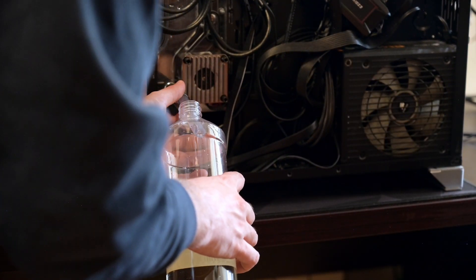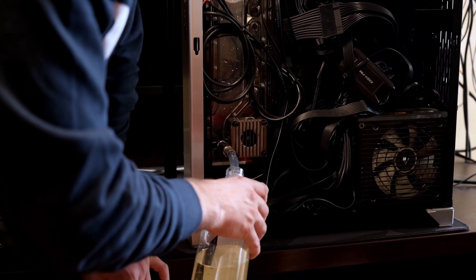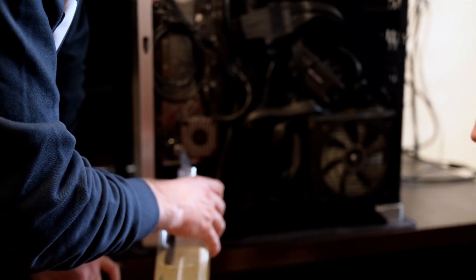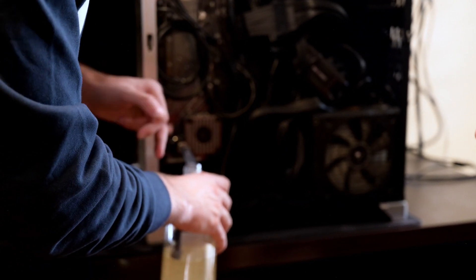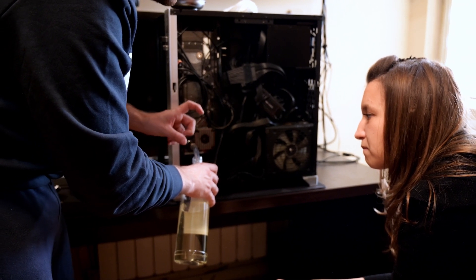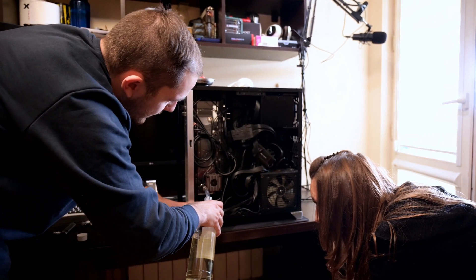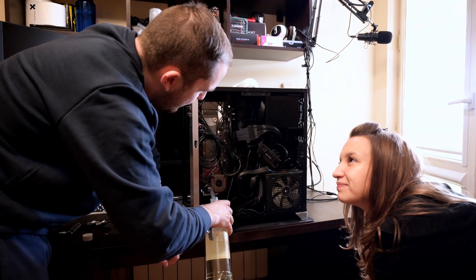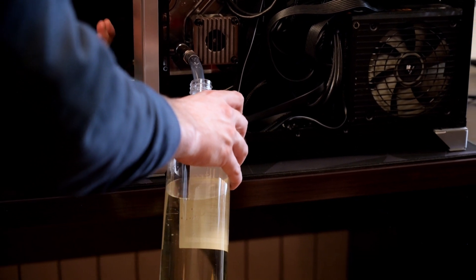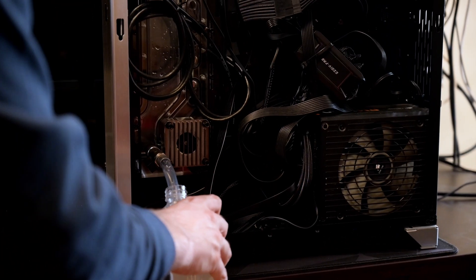Oh my god, this will take time. Why we're draining the system so slowly is because we haven't obeyed one really important rule: when you put your draining port, you need to put it in the most bottom part of the liquid cooling system. The radiator is lower than the draining port right now, so we wait for air from the radiator to very slowly push the liquid out of the system.